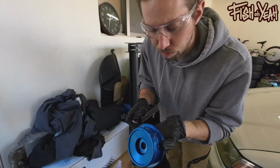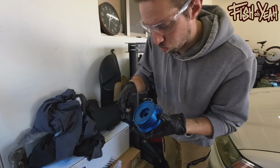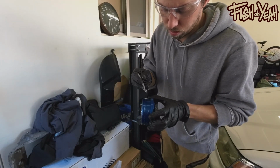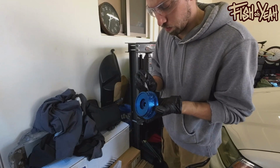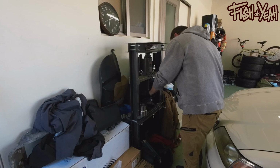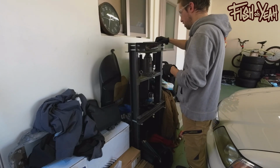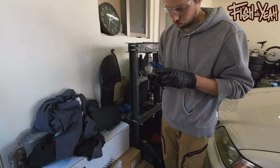Normally, for a machine fit, I would just go metal to metal, but since I have a little bit of corrosion there already, a little bit of grease to coat it won't hurt anything. This is what I'm going to tell myself. Again, I'm sure all the tolerance kings will be like, oh, you can't do that, blah, blah, blah. Something galvanic. So, that's something. Plus that saves me a boatload of hammering. Oh yeah.